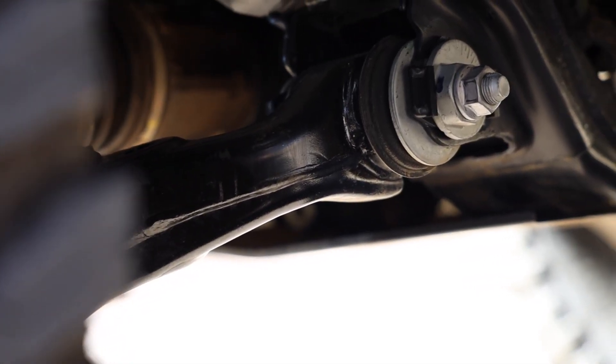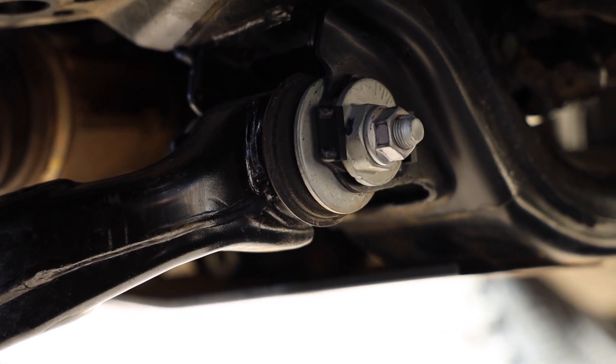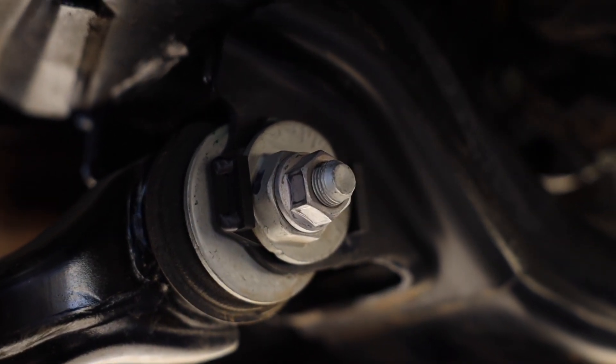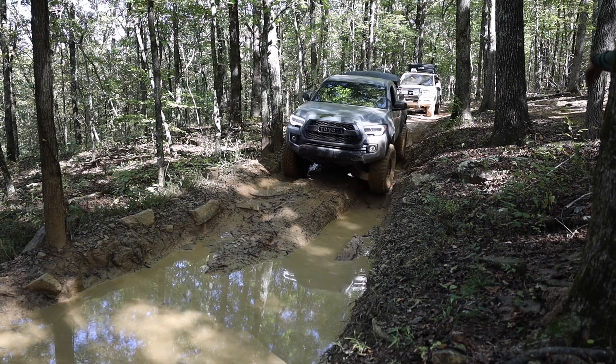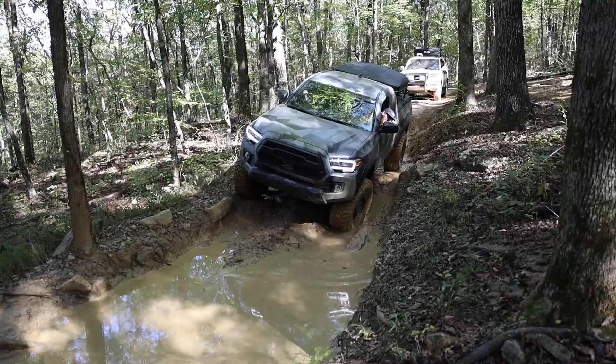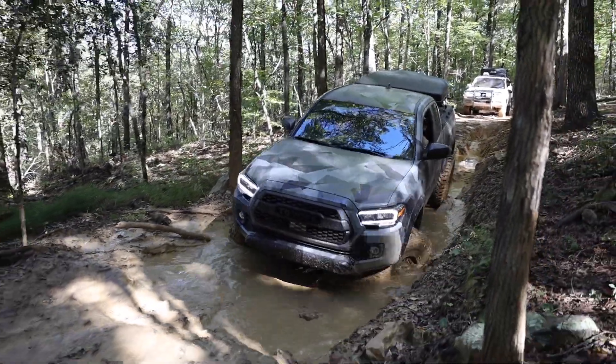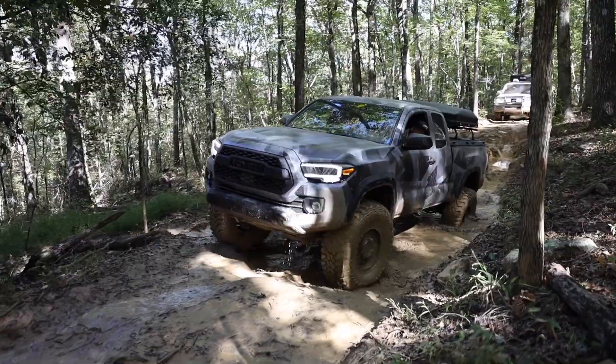For another thing that's a little bit hard to see on the truck — I'm going to try to throw in B-roll — we've changed out the cam gussets. The guys at Running for Tacos installed the Dirt King Fabrication alignment cam gussets, and essentially what these do is just beef up all of your connection points for your suspension. A lot of times when you're wheeling really hard, if you're bumping into rocks or slamming into things a little bit too fast, your alignment can get knocked out of whack. Without reinforced cam gussets, chances are you can bend stuff in there, and almost every time you get off the trail you might have to go in for an alignment. Luckily I didn't knock the truck out of alignment in Arkansas, but with these new cam gussets installed, I probably won't have to get this thing realigned — hopefully ever.